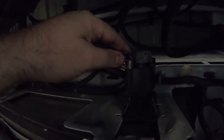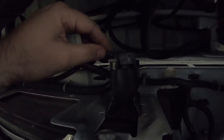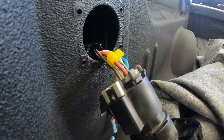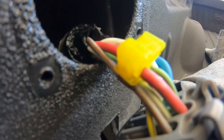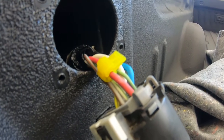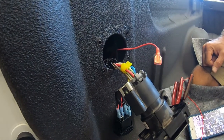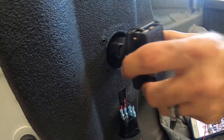Our connection wire is right here on this specific truck. Depending on what truck you have it may be in a different location, but what we're looking for on the GMC '18 trucks is a red wire with a green stripe. You're going to tap your T-tap into it and plug your cable in, zip tie it up, and you're good to go. We put the T-tap in on the red wire with the green stripe on this GMC 3500, and now that it's connected we can route our cable through and hook it all up.